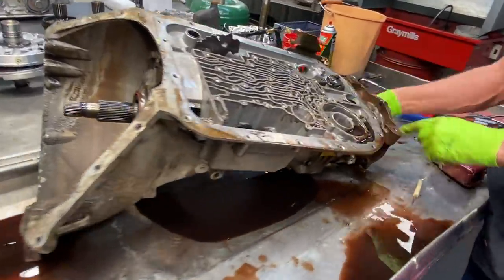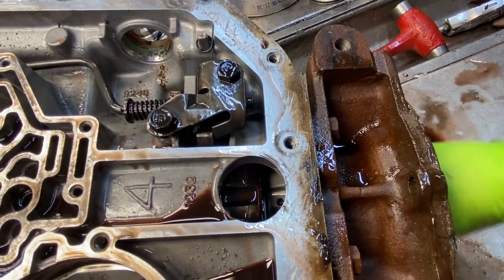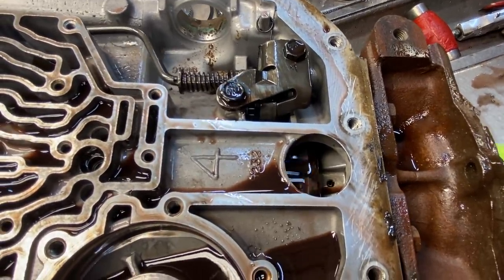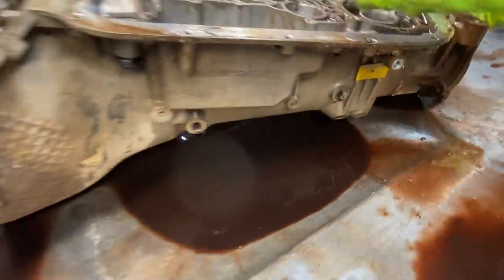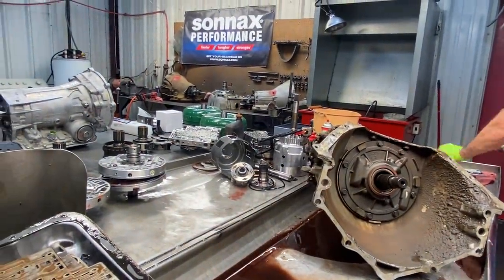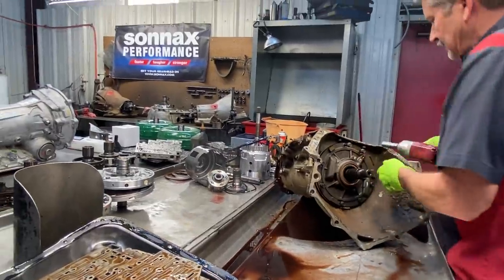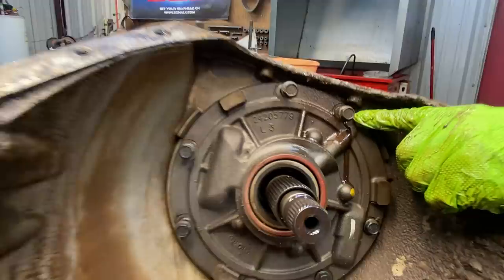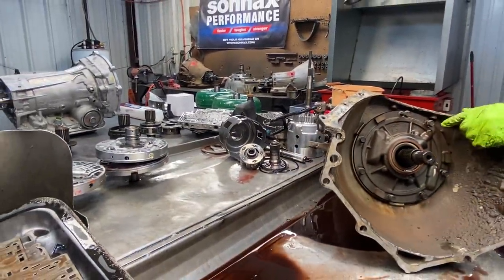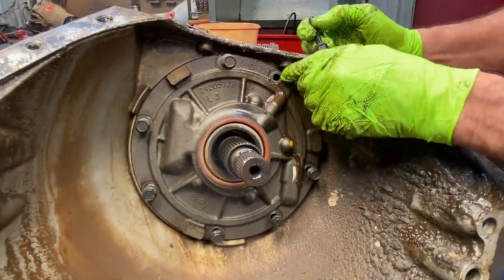You can see your park linkage through here. Anytime you put it in park it locks right in. Do you ever hear that clicking? That's what you're hearing when you put it in park before you come to a stop. Did you see that oil just pour out of that bolt when I took it out? That's why we highly recommend double sealing your bolts — the pressure getting in there fills that bolt hole up, and if that seal got hard or shrank, it's going to leak right out of that bolt.